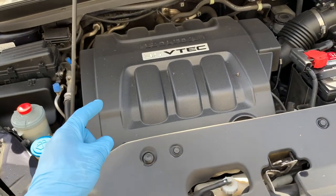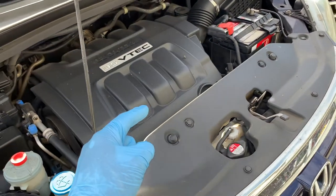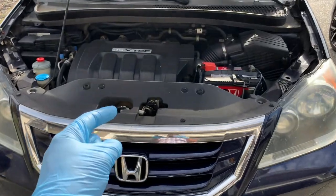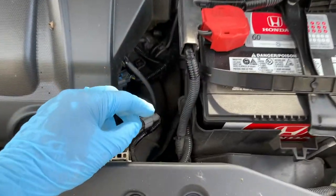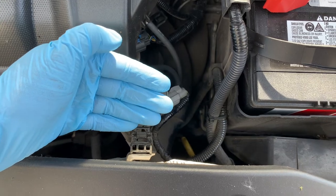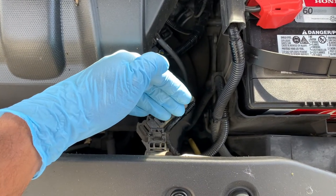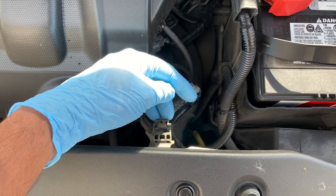Also try to visually inspect your transmission by looking under the vehicle for any fluid oozing out of it. For example, does your car leave spots of reddish fluid on the ground after it's parked? If you notice transmission fluid loss, contact a mechanic as soon as you can. A transmission fluid replacement will not destroy an older vehicle's aging transmission — typically when a transmission has issues after a fluid replacement it's because there was already an internal problem such as a worn clutch pack. If your transmission is healthy, a fresh change of fluid will only help its longevity.